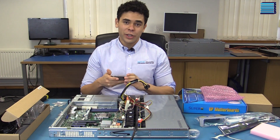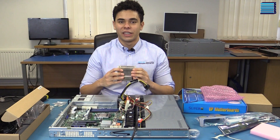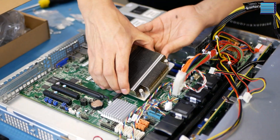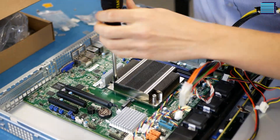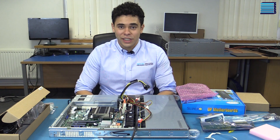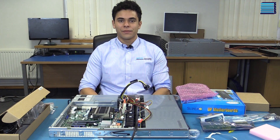Cooling the CPU, we're using Supermicro's 46P heatsink designed for the E3-1200 series processors. For the RAM, the customer has opted for just one stick of 8GB of DDR4 ECC unregistered memory, leaving plenty of capacity for upgrades in the future.